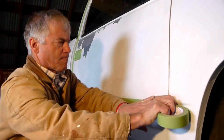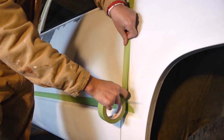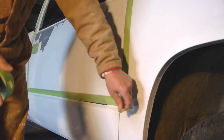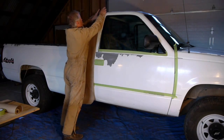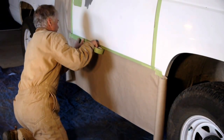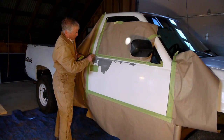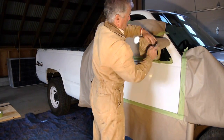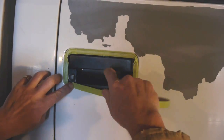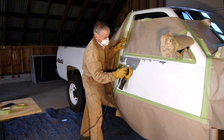First, tape off the surrounding area. Using automotive quality masking tape and protective paper, mask off the areas you wish to protect. Do not simply outline the damaged area with tape, as you will create a distinct paint line which will show up when you remove the tape. Professional shops will often paint to a boundary, such as a panel line, molding, or the edge of a door. The idea is to blend the paint from the damaged area into a larger undamaged zone without leaving any noticeable paint lines. Also, make sure you cover any door handles, windows, mirrors, or anything else you do not want to paint.